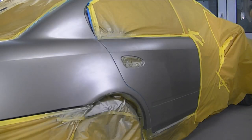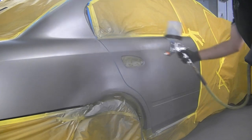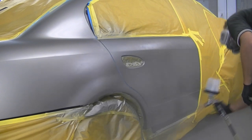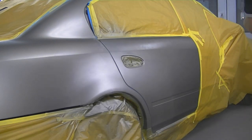You can see that the primer is still visible if you look carefully. So again I used the orientation coat at the beginning and I'm going to taper the paint out a little bit further, angling my gun in sort of random ways as long as it's covering the primer and not going all the way to the edge of the front of the door.